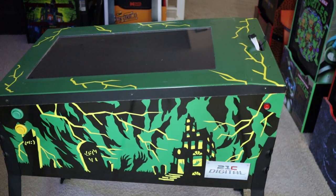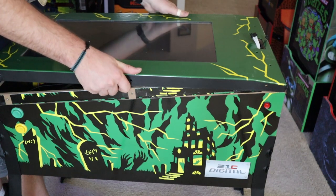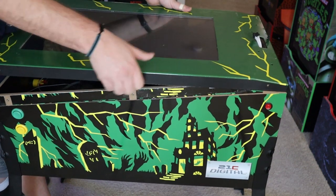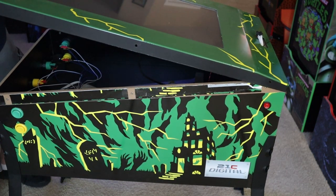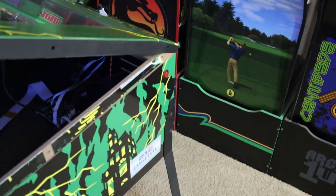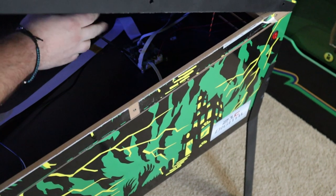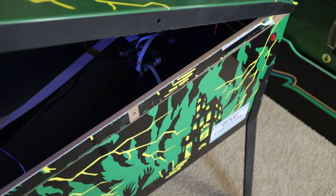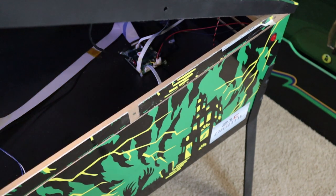Now we're at the very exciting part — we've got to get the monitor off, and you've got to do this very slowly, very carefully. It is very heavy. You want to very carefully start to lift the monitor off of the cabinet. It's a very tight, snug fit, and when you do get it separated, do not lift it too high. There are two wires connected to the monitor that connect it to the internal guts of the arcade machine. Those two wires are the LVDS cable coming from the monitor to the motherboard, as well as the power cable connected to the voltage regulator board inside the pinball machine.